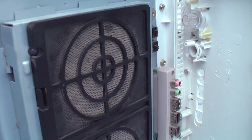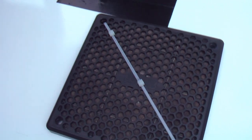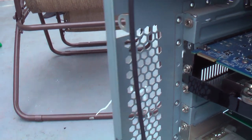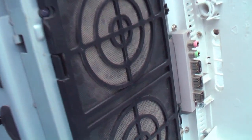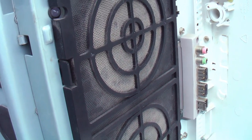The first thing you should do is check all of your intake fans and make sure they all have filters on them. All three of mine do. If they don't, you can buy filters online for pretty cheap. Make sure they're fine mesh filters — something like this isn't considered a filter, this is just a vent. It doesn't prevent any sort of dust from entering the case. If you have a mesh filter on that, it should prevent large particles such as hair from entering the case.